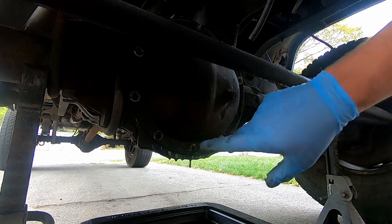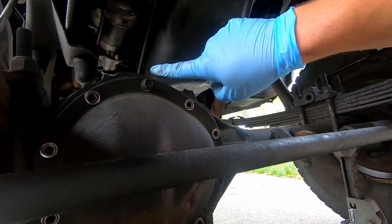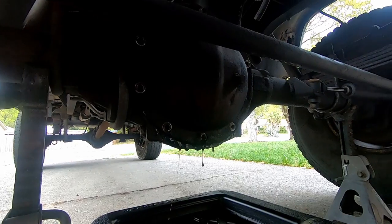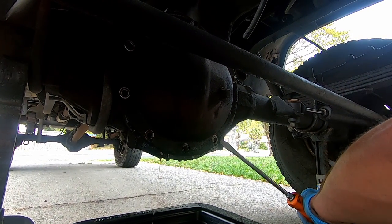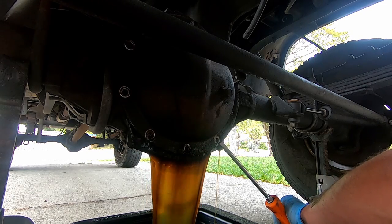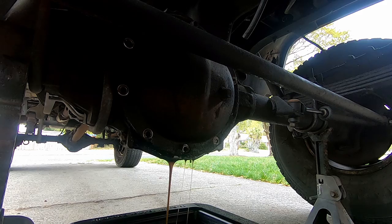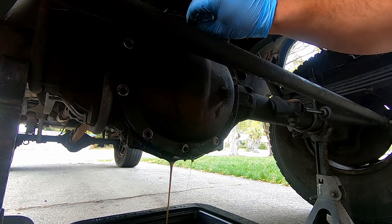The best way to knock this cover off to drain it: take all the bolts out and leave that top bolt on there, leave it finger-loose. Then just take your screwdriver, get in behind it, and just give it a little pop. Oh yeah - oh, this is stanky. Super stanky. They didn't have a whole lot in there - that wasn't good.